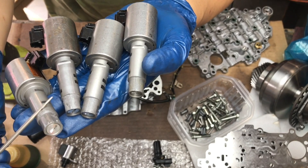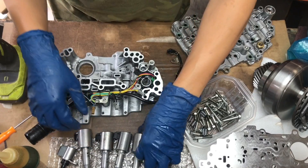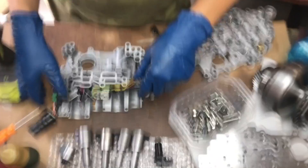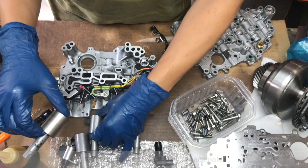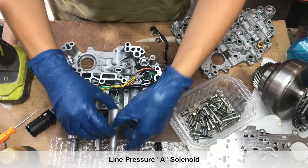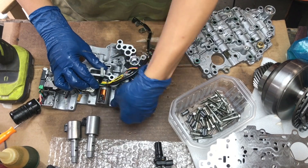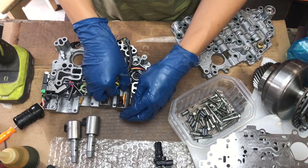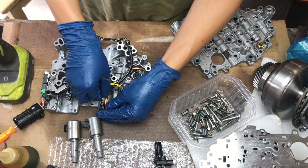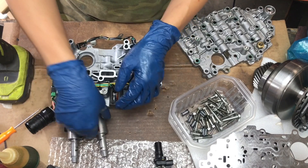The other solenoid here — the retaining pin will go on top, right here in the front. The three identical ones go here, here, and here, and the one that's different goes here. Before you put them in, put the connectors in first. You can't mix up these connectors because their length only reaches where they're supposed to go.